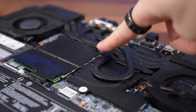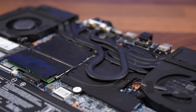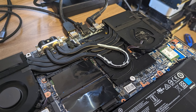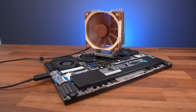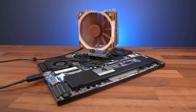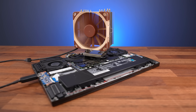This laptop has an extra metal loop on top of the regular heat pipes for its optional water cooling. To use the air cooler, literally all I've done is put a bit of thermal paste on this pipe and stuck the air cooler on top of it. It's definitely possible that a different laptop would work better with the air cooler as there would be more coverage with the cold plate, but I still found this to work quite well.